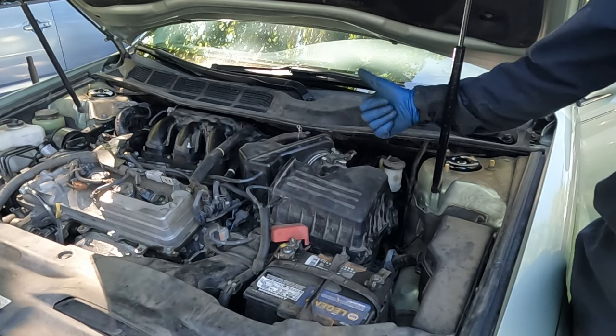Shut the hood and make sure the wipers swing properly — repair complete! That's how you replace spark plugs on a Toyota Avalon. Overall, not too challenging. Getting to those back three plugs is a little extra work, but not the worst. The key is unbolting that harness so you can flex it out of the way — otherwise you can't get the coils out. A two-piece extension or a flex joint adapter works great for accessing those rear plugs. Thanks for watching — like and subscribe!